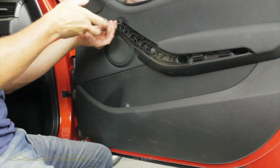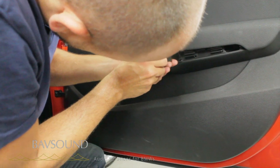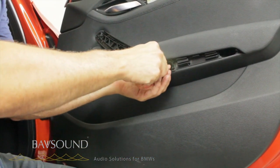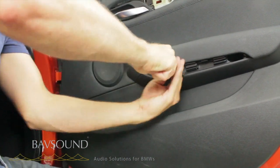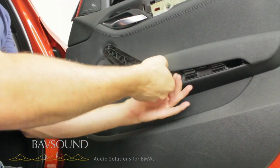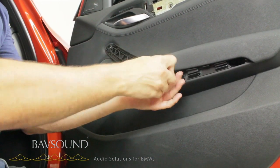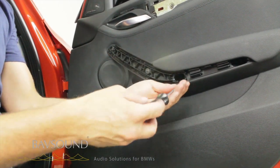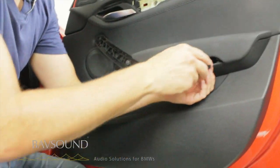You've got the gist. You really don't need to watch for the next minute or so while I extract these until we actually get to removing the door. Now you've got to go fishing down in there until you find the screw. And again, these are tight, so don't think you're just going to spin them out of there. Be very direct in the extraction — firm inward pressure while turning — because otherwise you might strip it and then you can't get the door off.